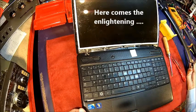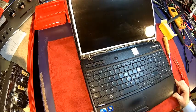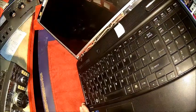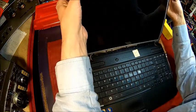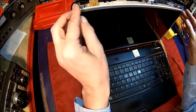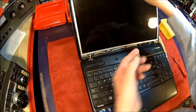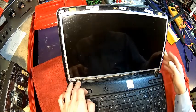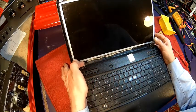I've got the feeling this is an LED display. So what I said is probably not true — the issue may be a hinge cable problem. I was expecting an LCD inverter down here but it looks like an LED backlight. This is Wi-Fi, that's the camera, and on this display we only have one cable, so it's most likely an LED display.